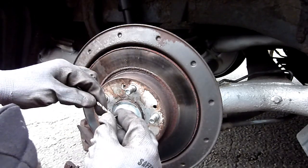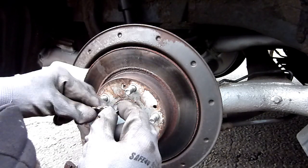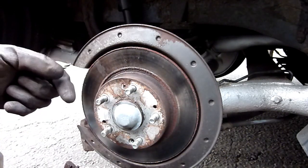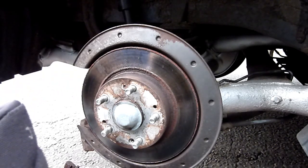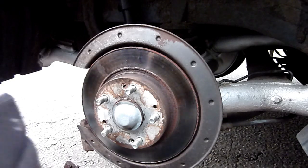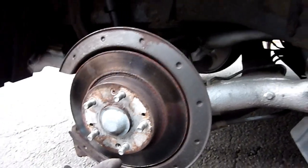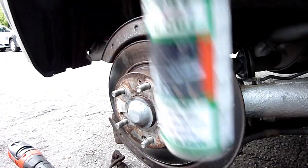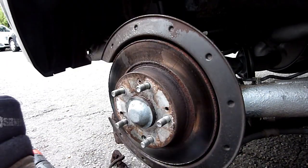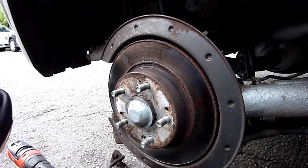You want one that is smaller than the diameter of the inner thread of the screw, so I used 4mm. So this is how to drill out these stuck screws on a rotor — they'll all be pretty much standard size. First, a few bits and pieces: penetrating oil, some cutting oil — you can get these at Tool Station quite cheap — and brake cleaner.